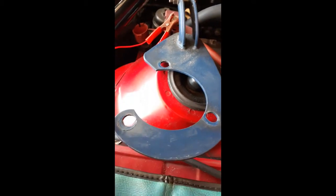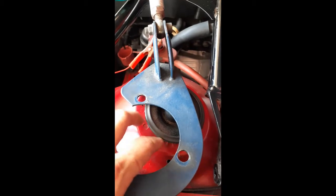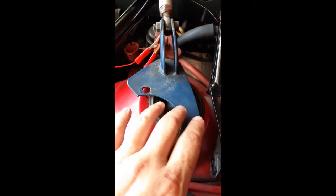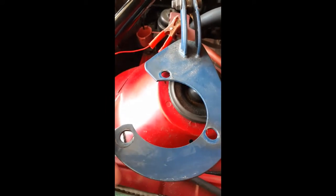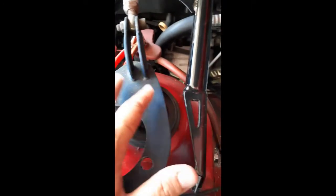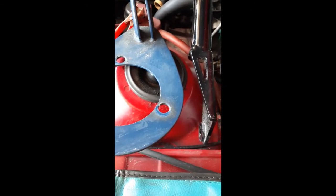This is a strut bar. As you can see, this has 3 holes. This would actually hold that entire strut, the whole thing, in place versus the strut tower. So if you could imagine this guy, now they're different, yes, because this is actually for a Nissan Sentra. But as you can see, the bolts would come off for the strut itself, this guy here, and you would just kind of put this guy in here, here, and here, and this would hold itself, holding the strut itself stiff. Versus this guy is actually holding the entire tower, which holds the strut in its place. It's kind of the same shit if you think about it.